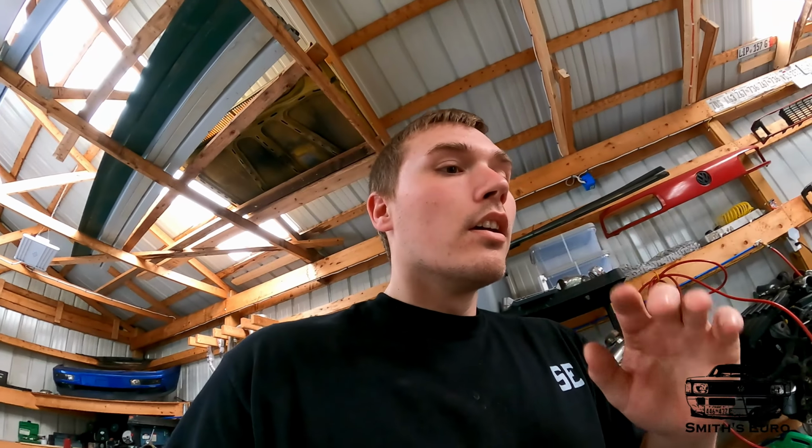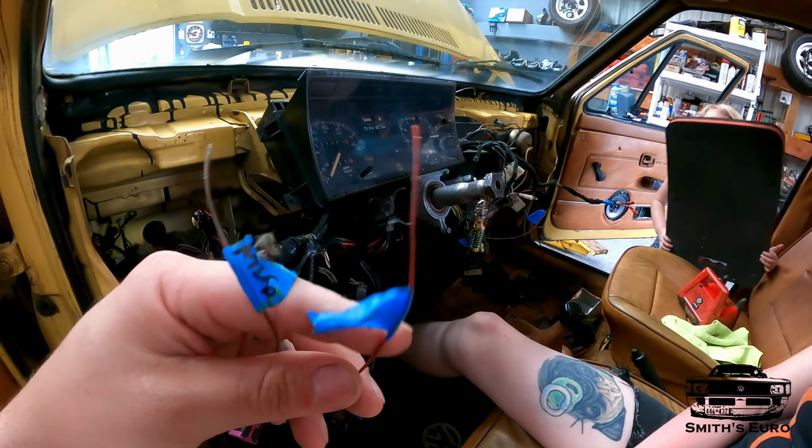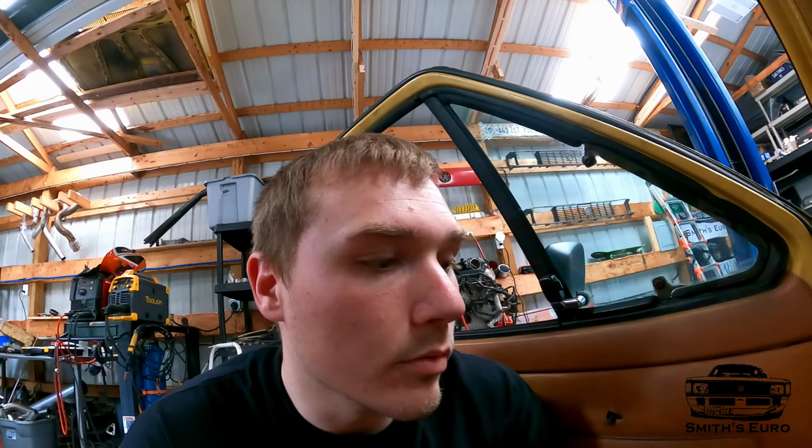So now that nothing's caught on fire and I hear stuff clicking up there, it sounds like the fuel shutoff valve is clicking, which means it'll let fuel in. So what I'm gonna do now is ensure that the ECU is on. I'm gonna take the VAGCOM plug and jump red to power and brown to ground, and then we'll be able to connect this to my computer.